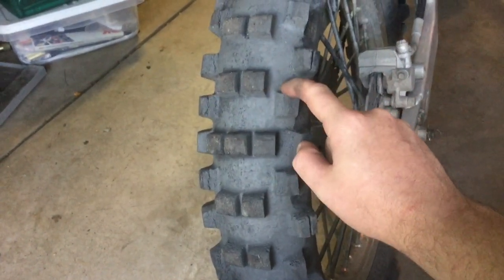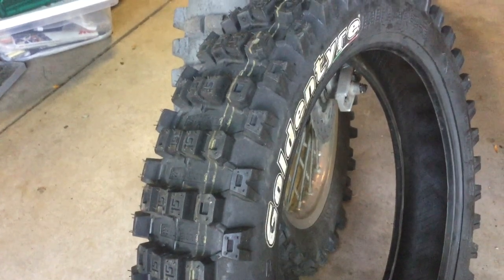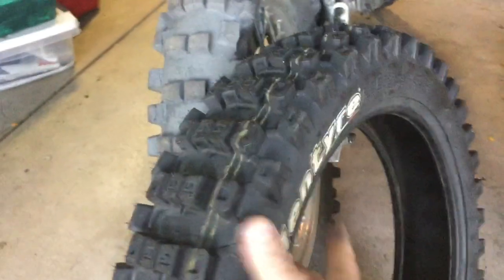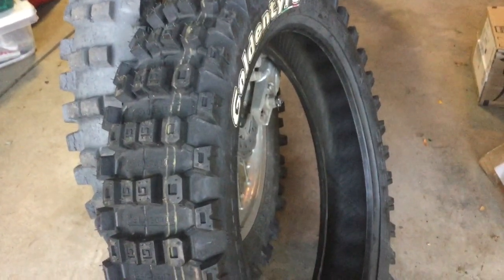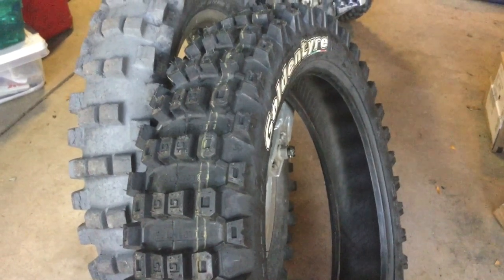The Shinko sticks like glue on the rocks — super happy with that tire. I don't know what the GT333 is going to do, even compared to the Golden Tire GT216 standard rear, which is not a gummy tire. I can twist the knobs on the IRC VE33 that came stock on this bike, but I can't budge these GT333 knobs at all. On the other hand, the crown of this tire is much more flexible than those tires — it's a mystery. It's a 110/100 and looks really wide off the rim, so let me go ahead and mount it and we'll see what it looks like.